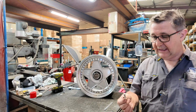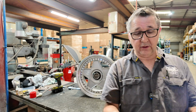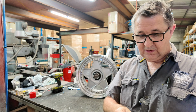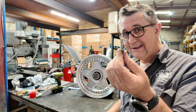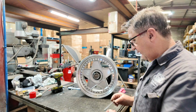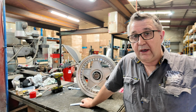So the Autostrada, as I mentioned before, they use a high tensile stainless steel bolt, right? Don't throw them away. They're really good. The nuts go a bit rusty and crappy, but the bolts will never rust, so you should hang on to those. This high tensile stainless steel is difficult to get these days, so you always hang on to these bolts. And the interesting thing for a three-piece wheel, the standard bolt generally in a three-piece wheel will be an M7 by 32.